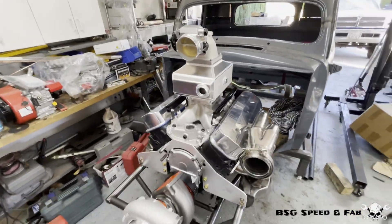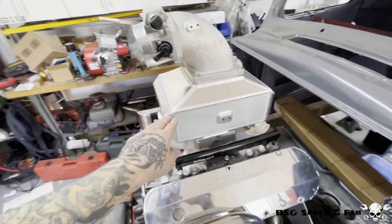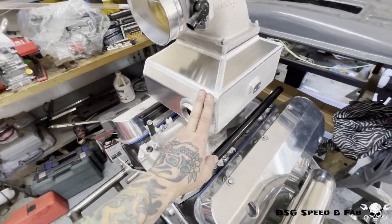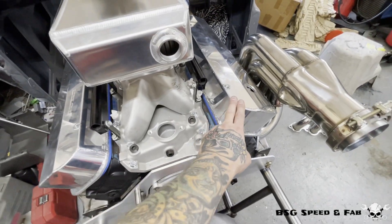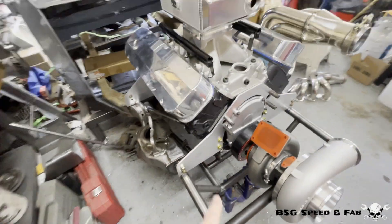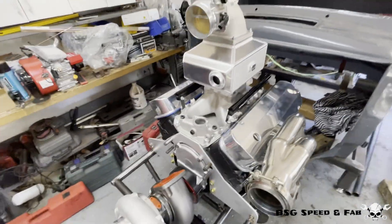If this doesn't get you guys excited, I don't know what to tell you. Let's start up top: got a 102mm throttle body, Holley EFI elbow, custom-made air-to-water intercooler with a 1300 horsepower rating core, flanged for a 4500 series intake manifold. Then a Holley EFI intake manifold oval port to match the Gen 4 big block Chevy heads. Then a Gen 6 454 bottom end, rebuilt 30 over, gapped for boost, comp cam, comp valve springs and retainers, roller rockers — solid running motor.